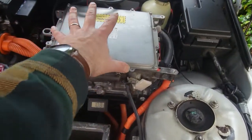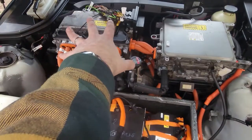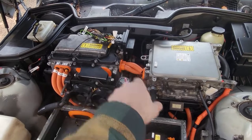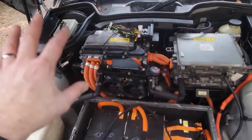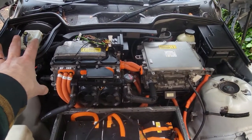What I really want to do is bring this forward and drop it down, bring the inverter over to the centre, possibly even rotate it through 90 degrees, and that will create more space for heating, which has to go over here, and for my brake booster, which is currently completely inaccessible and needs to go over here.